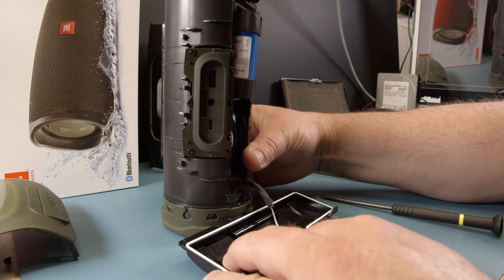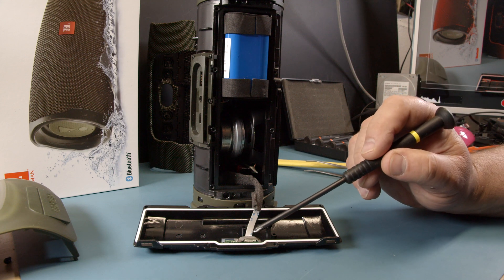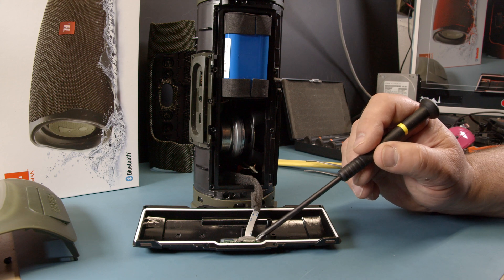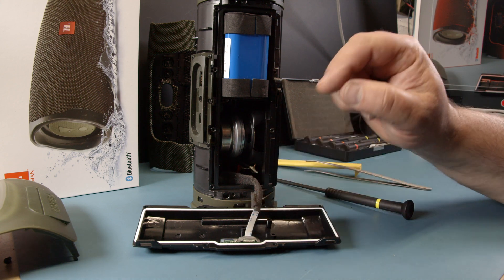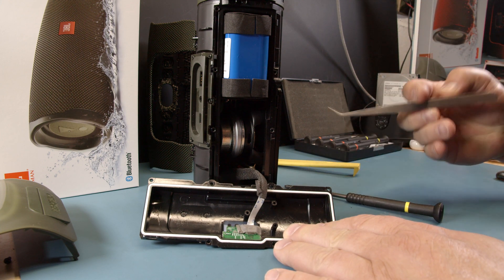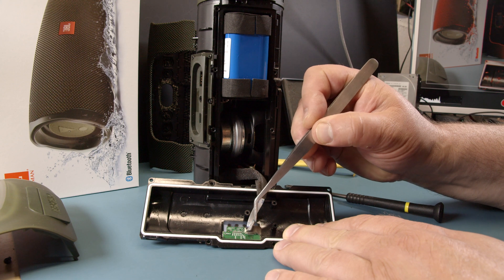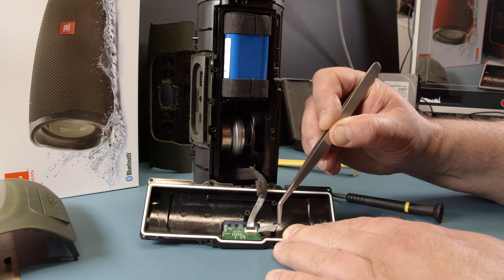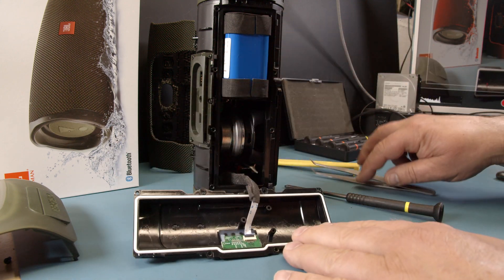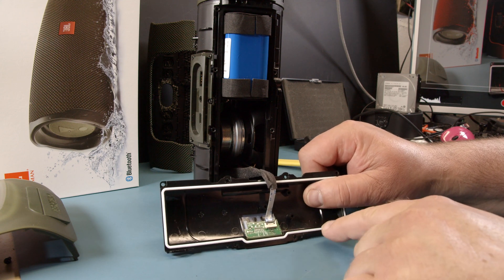Put this to the side. Down here it's glued on with a tape. You can unhinge this here from the contact here. You have to be careful — don't go in there with metal. I know what I'm doing; I'm not touching any metal. This is just to secure it, and if you rip this out, then you are out of luck.